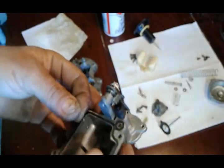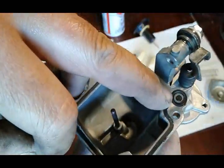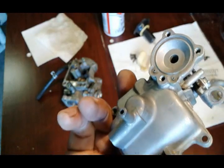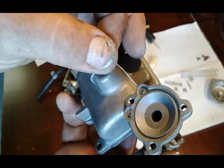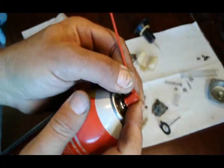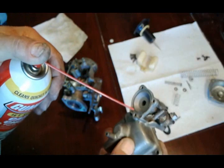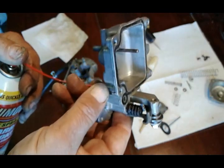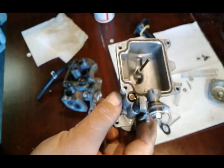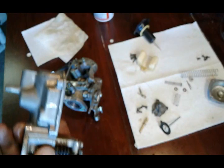Another important part is right here in your bowl - this has to be open. The opening is right on the other side. Attach the nozzle on your carburetor spray and you should be able to see it spraying through - you see it? This has to be clean. If this is clogged up you gotta blow some more air through it or whatever you gotta do, because that's your delivery of fuel.